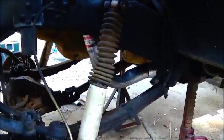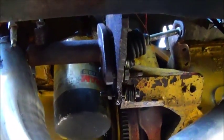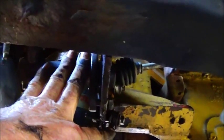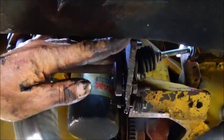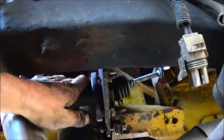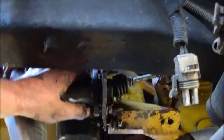with the hydraulic clutch. And if you hadn't seen it, there it is. It's coming up and hitting the exhaust on this end. It's loose. It's crooked. Bolts ain't in it. We got a stack of washers here. This bracket that comes out against the frame, I might at least try to tighten it down a little bit before I go to move it. I didn't even notice that.